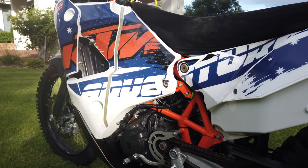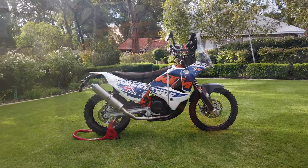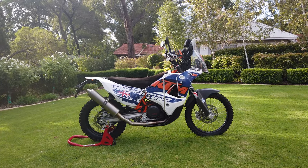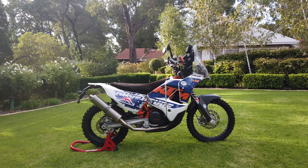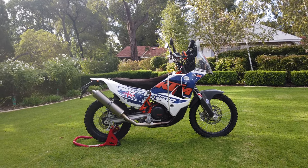The only downside is that if you're in the middle of Siberia trying to find a new tyre it can be a challenge. The bike's done just over 50,000 km — 45,000 of that was going around the world about two years ago. I'm pretty fussy about maintenance: every 5,000 km it got oil and a good check over, and every 10,000 km the proper service.